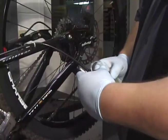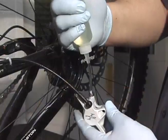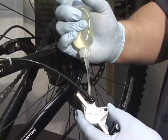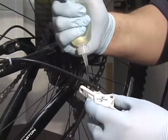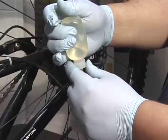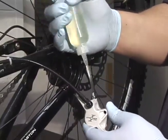To begin the bleed, I'm going to open up the caliper bleeder about a quarter turn. If I have any air in my bleeder hose, I squeeze it up into my bleed bottle to prevent pushing any air through the brake system. I want to make sure I clear the caliper of any air, so I squeeze for about a five count and release for about a three count. While squeezing and releasing, I can rotate the caliper a little bit — generally at about a 45 degree angle. If the bottle starts to collapse, grasp the head of the bottle, slightly loosen it, and let some air in to inflate it, then continue the bleed.